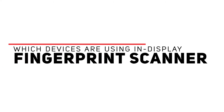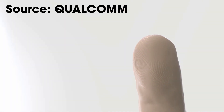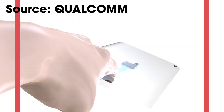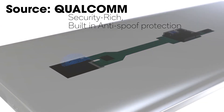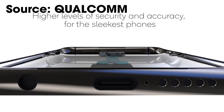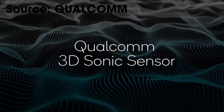Which devices are using in-display fingerprint scanners? Because it is a cheaper alternative to the ultrasonic scanner, a wide range of devices use the optical scanner — all major Chinese smartphone manufacturers including Vivo, Oppo, Xiaomi, OnePlus, and Huawei ship their flagship phones with optical scanners. Even upper mid-range models like the Oppo, Vivo, and Samsung A50 integrate optical display scanners. The ultrasonic fingerprint scanner only supports the Snapdragon 855 platform, and only big flagships use it because it's complicated and costly — the most recent examples being the Galaxy S10, S10 Plus, and S20 Ultra. That's all for now, thanks for watching — my name is Hamza, this is Tech Filter.